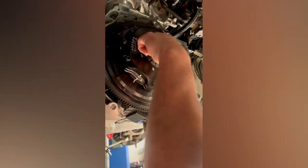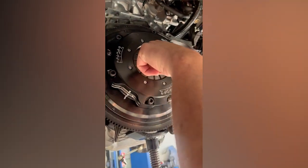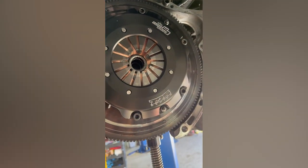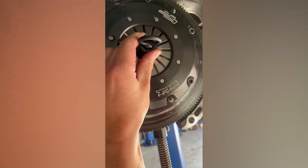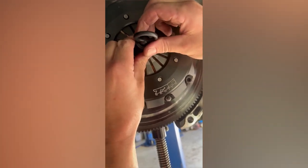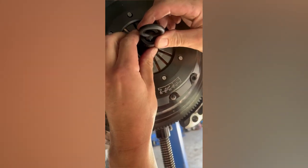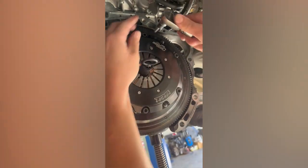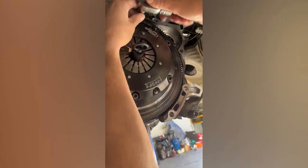This is really critical, because it's a twin plate. If you don't get this second plate lined up here, when you put the gearbox in, it can actually hit it and it won't fit. So what I do - put your dummy shaft in. See how that's tight? You don't want it tight. You actually turn the plates back and forth, give it a little weight off it, and just nip it up a fraction. That's where you want it - really loose. A few moments later.